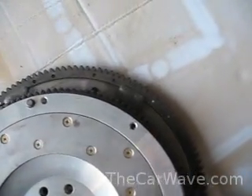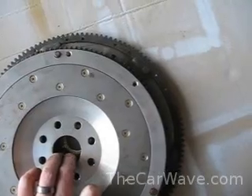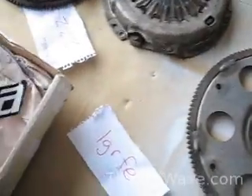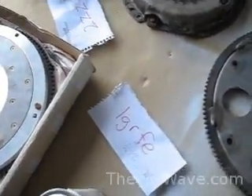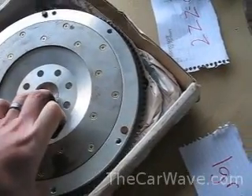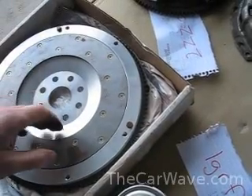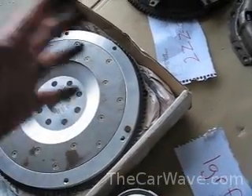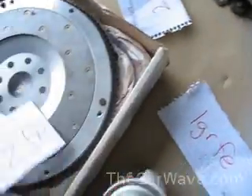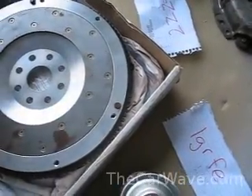Your starter would have to be figured out because the sizes are just so radically different — there's no way that this ring gear would work at all, and the starter position would be way off. The whole point of using this would be to adapt a different transmission to it anyway, but it doesn't mount. There's no way. The entire transmission rests against the motor, and you could put the bolts all around the outside perimeter without getting a single one interfering with the transmission. It's that much smaller — it's kind of ridiculous.